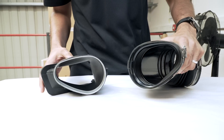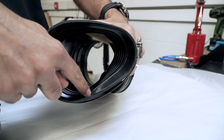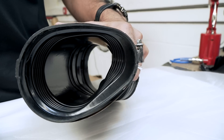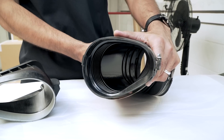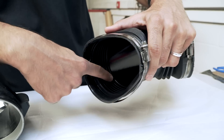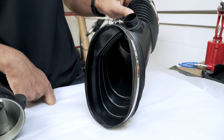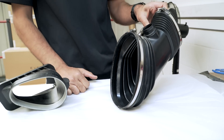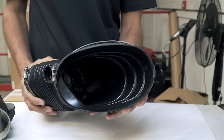The flexible part of the tube has a large wall right there, which is exposed to the downstream airflow. So as the air goes through the tube it hits that face and creates further turbulence. You've also got the two concertina portions — the first one there and the second one on the other side. This is important to let the tube flex, but it introduces multiple surfaces for the airflow to bounce off, creating more turbulence.